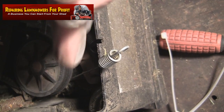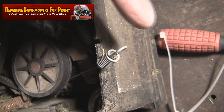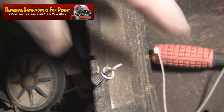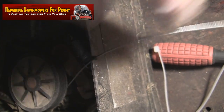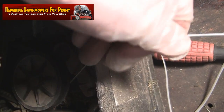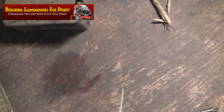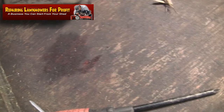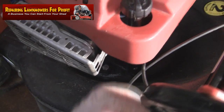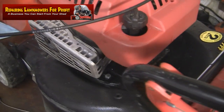If you basically pull this towards where I'm standing — towards the front rather than the back of the machine — it's a lot easier. It's more of a motion of sliding it off the end rather than pulling it back. With that out, I can pull the cable through. As you can see, the broken end of the cable is here. The cable has basically pulled itself out of the housing, so I need to remove the housing as well. Just give it a firm pull up and we've got that off.